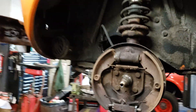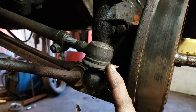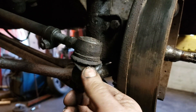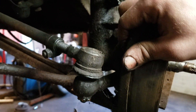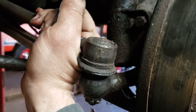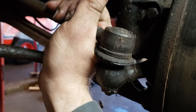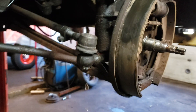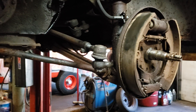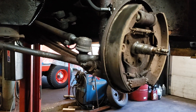It's hard to get the full scope because the wheel's not on, but this tie rod pulls like an eighth inch out of the cup when you wiggle it. Look at the stuff falling out of it. With the tire on it, it gets really wild. This outer is shot, both inners are shot. I just ordered both inners and both outers because they were like five dollars a piece.